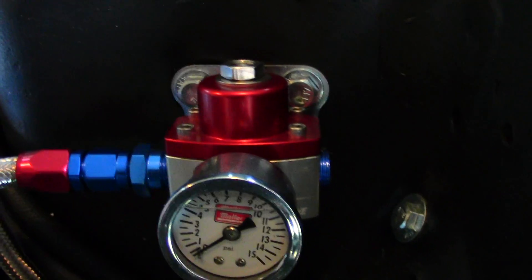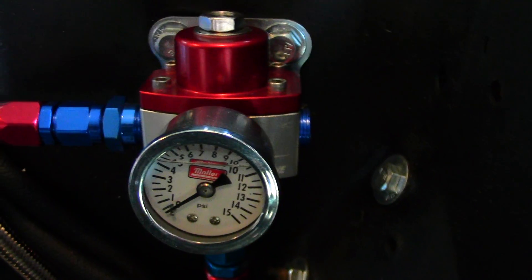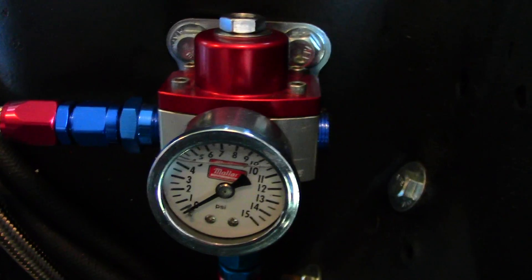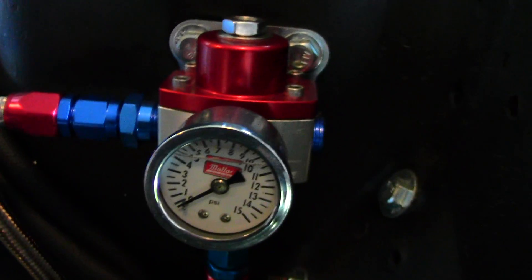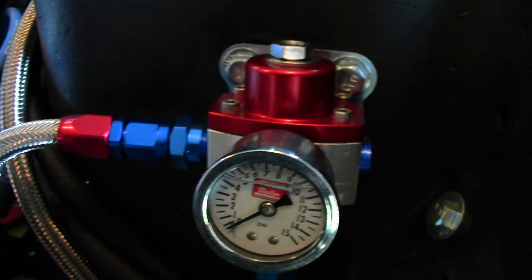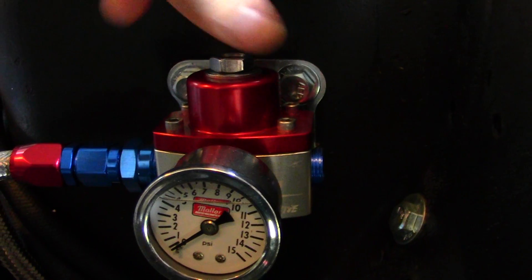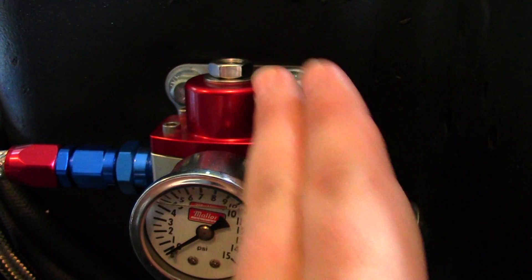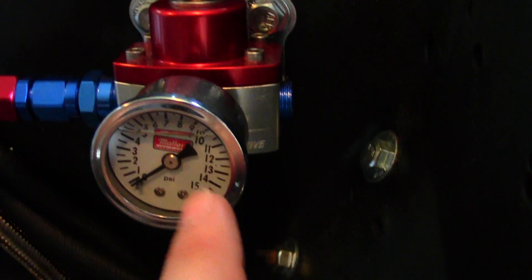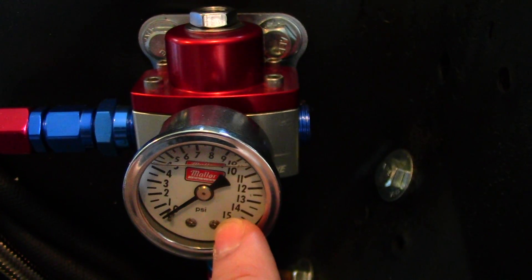The pressure is regulated by using this Allen key with a lock nut up here. What you do is run your engine, check your PSI, and look at the specification for your carburetor. Holleys like to run between six and seven PSI comfortably — some are five and a half, some are six and a half; it depends on your setup. You want to check the spec on your carb and match that to your pressure on your regulator. You do that by turning it in for more pressure and turning it outward for less pressure. The Aeromotive fuel pressure regulator does not come with a gauge — I'm running a Mallory liquid-filled gauge that maxes out at 15 PSI.